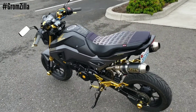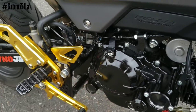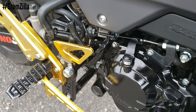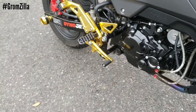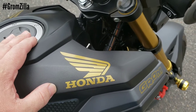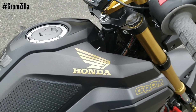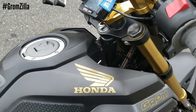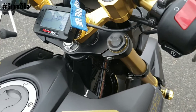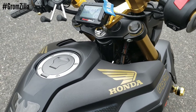So here's Gromzilla. You can see the mechanism here. I'll just squeeze in the clutch — switch is on, two-step is on. Right now the two-step is set to 7,250 RPMs and the rev limiter is set to 9,750. I believe stock is at 9,250. I'm going to put the camera down and show you what rev limiter is, and then show you what two-step is when the clutch is in for three and a half seconds.